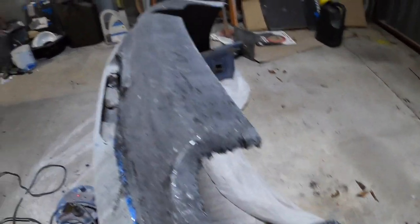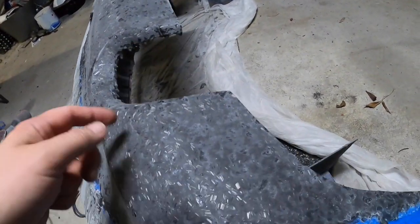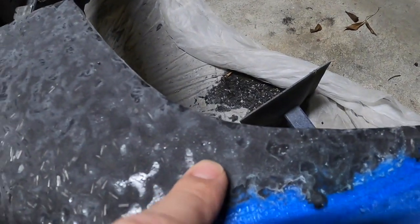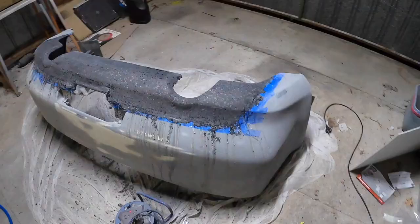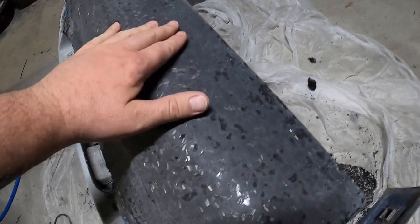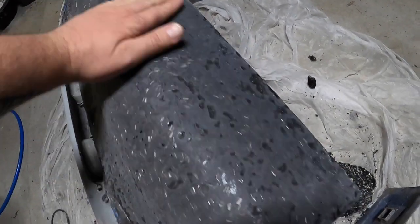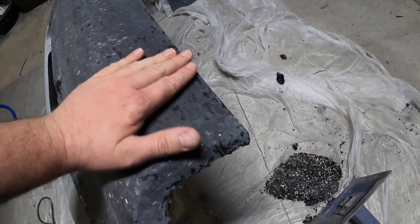I'll get the air compressor on for a little bit and just go over it to blow out all the little spots — you don't want to clear over that. I've got the air onto it and I wasn't too happy: this part still had the light yellow epoxy there, so I did a sand, blew it off again, and went over it with some prep wash.